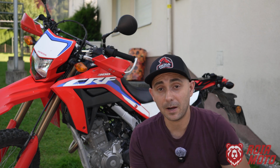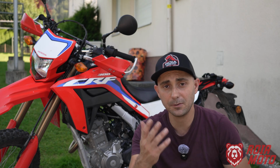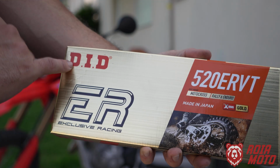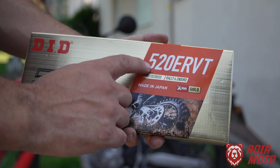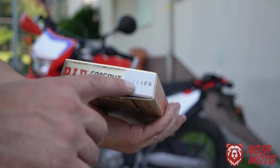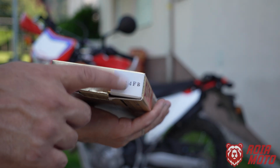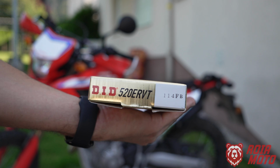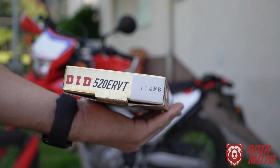Now let me start by showing you which parts I'm buying, in case you want to buy the same. I bought this with my own money, that's not a sponsored video, but in case you're interested, here it is. I'm getting a DID chain, the 520, which is the sizing of the chain, 520 ERVT, and I got one with 114 links. The reason this is longer than the original is that I'm also increasing my rear sprocket from 40 to 43 teeth, so I just got it a bit longer.